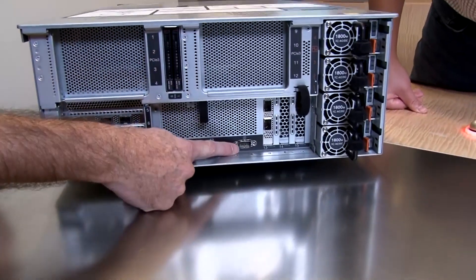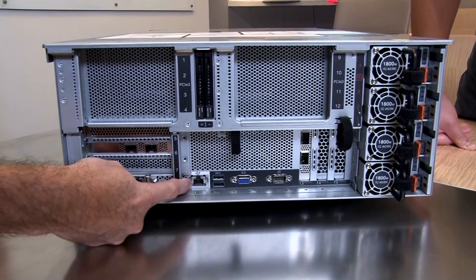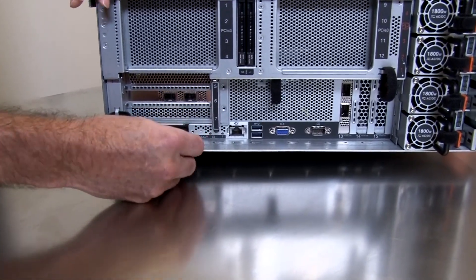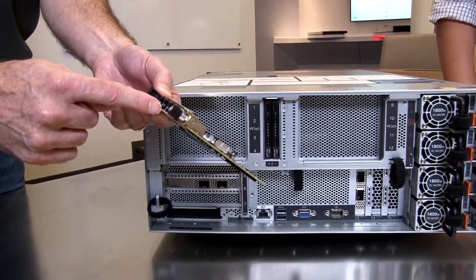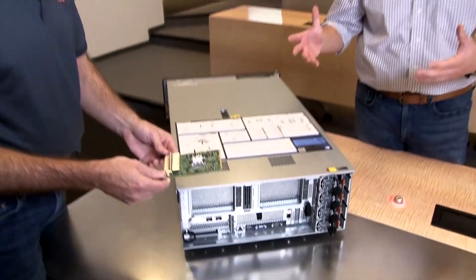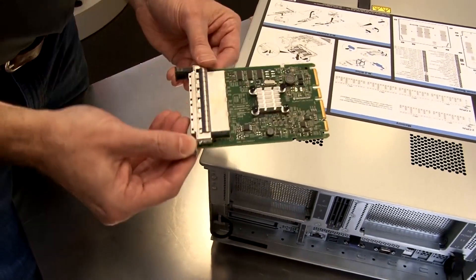The usual ports at the bottom include a serial port, VGA port, and two USB 3.1 ports. This is the remote management connector for XClarity control. And here's the OCP adapter — OCP is a new industry standard form factor. This one's a four-port gigabit controller, and we can go up to 10 or 25 gigabit connections within that OCP standard. With Intel moving to the OCP 3.0 standard, it means greater serviceability features because parts are easier to procure.